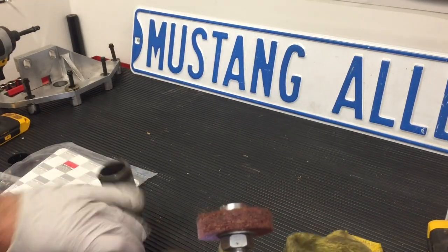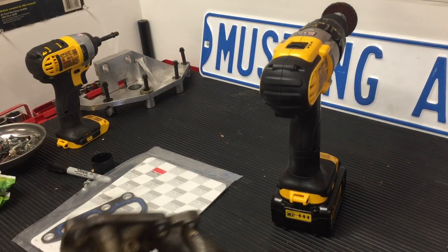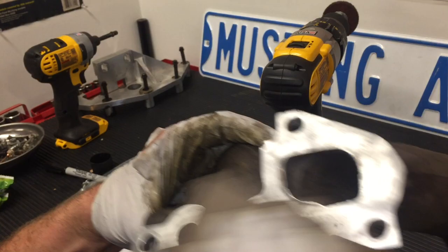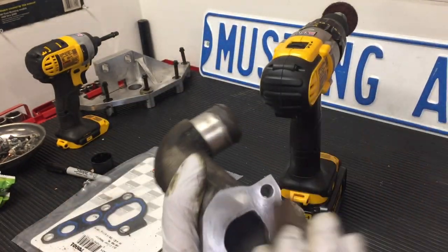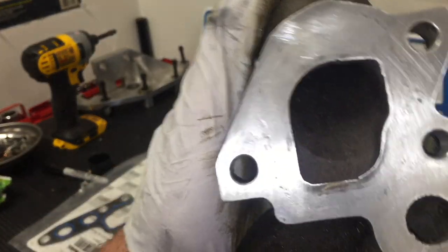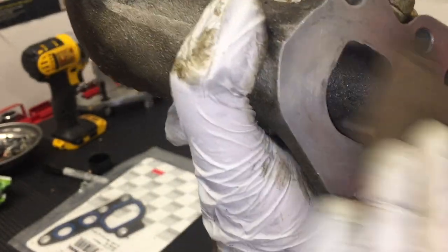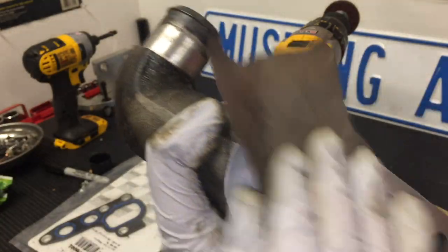With my safety glasses on, I'm going to go ahead and brush this with a drill and get it nice and clean. That looks pretty good — it's pretty smooth. We also have 1200 grit sandpaper, which is very fine, to get the whole surface nice and smooth and equal. You may get some slight pitting from the coolant eating away at it, and if you can't wear it down smooth, you can put a gasket maker in there to fill it.